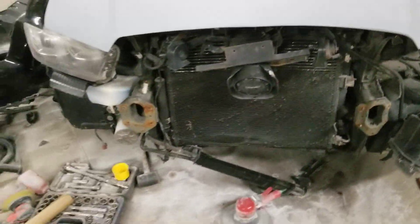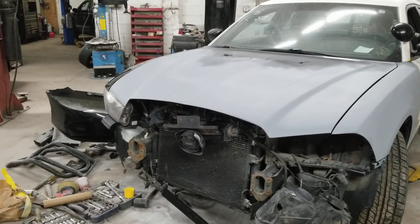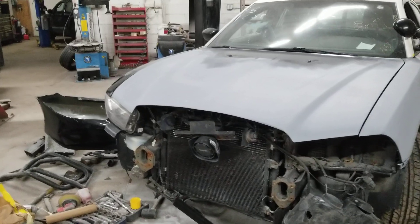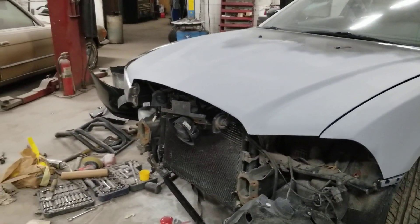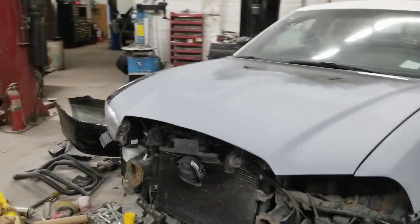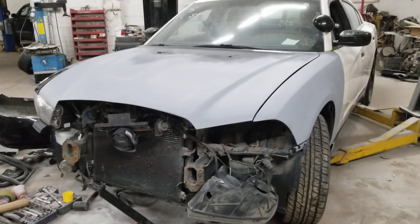If I've got to put a radiator in it, I'll put a radiator in it. The fiberglass is the trick here - a little bit of foam to firm things up, and fiberglass in that kink where it's designed to fold in half when you wreck. The hood did its job. I found a used one for $250 and was gonna buy it, but I decided to try to fix this one. Longevity? I couldn't tell you - this hood might last forever, or it might blow the body filler right out in a month. I haven't worked with aluminum a whole lot. The aluminum actually ripped - it ripped here and underneath too. That's why I packed it with fiberglass and put foam in there so it doesn't tin-can on me, then put fiberglass over it.